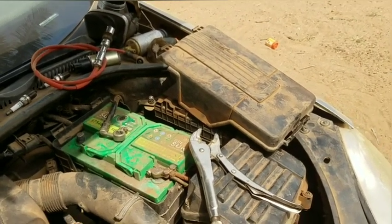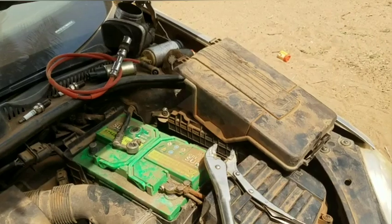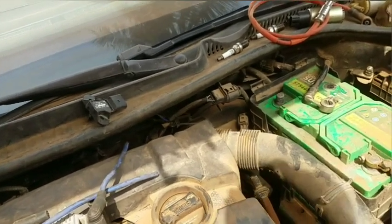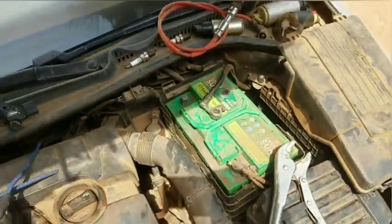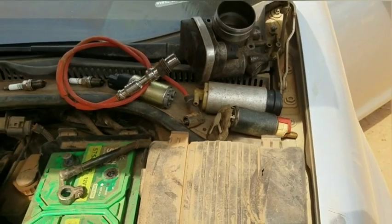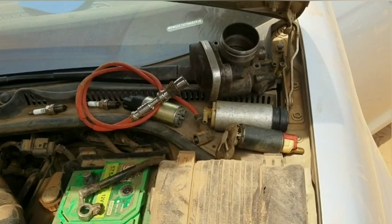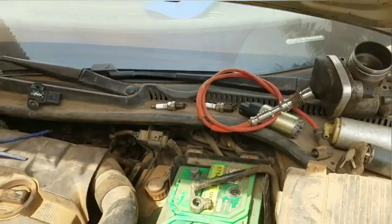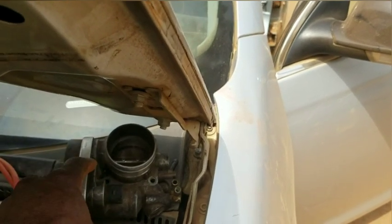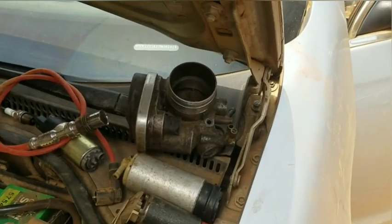So you now understand the first and second method of resetting your ECM, and you know the implication of what you're doing. It's not going to drain only the battery from the engine control module, the onboard computer. It also drains the power that goes into the ICs that control this. That is why in most Japanese models, if you do this, you're going to need to relearn the system. Again, you're going to need to relearn the throttle. And after that, you're also going to need some sort of driving pattern, which is going to set up the new algorithm that the computer is going to use to adjust the fuel trims of this very car when you drive around. So, because it pulls power from here as well, in most Japanese cars there is a relearn procedure after you do this, which you can do with or without a scan tool.